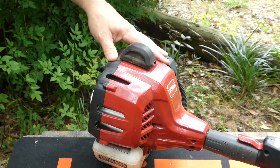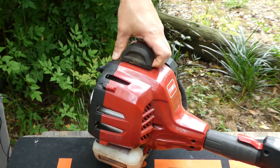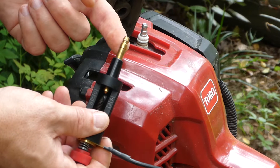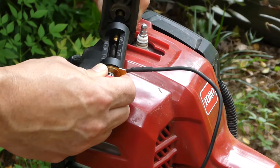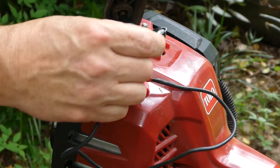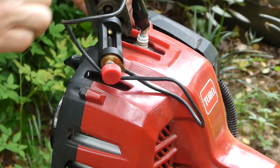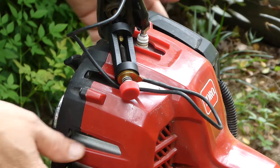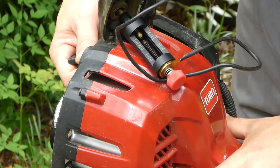For instance, this small trimmer. Let's imagine that we have a problem with this small trimmer and that it won't start. Let's check the spark. It's very simple. We just pull off the spark plug cap, use this plug to insert in the spark plug lead or the cap. Then use our other side, the clamp, and go directly to the spark plug. Now you actually don't have to go directly to the spark plug, but on this machine, because it's all covered in plastic, it's just easier. You can then watch our tester right here between the two probes and just pull it a couple times.